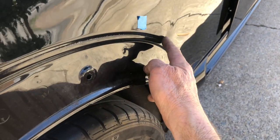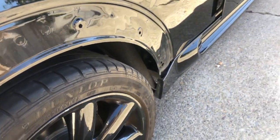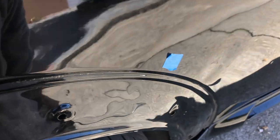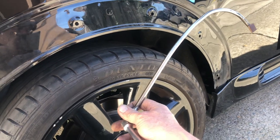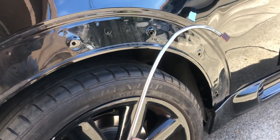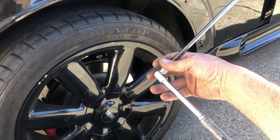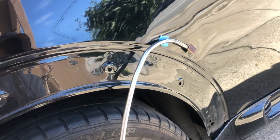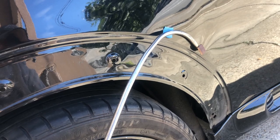Here's the point I got to get to — there's the hole. I probably already guessed it's going to be a hook tool or kind of a J tool. It's a short one — that's what you want. You don't want any length on it because you want some real torque. So I got a 3/8 socket on there. There's my hole — look at that, lined up perfectly. I'm going to get right in there and torque that out.